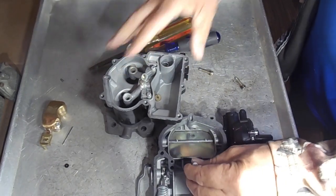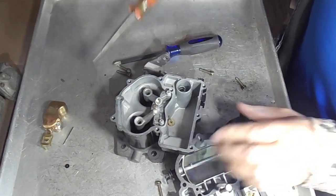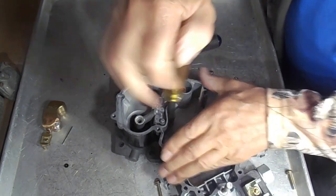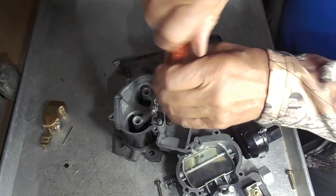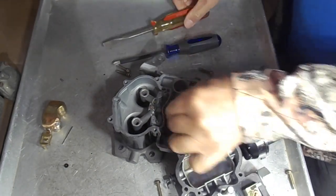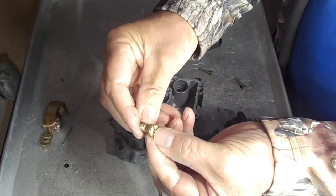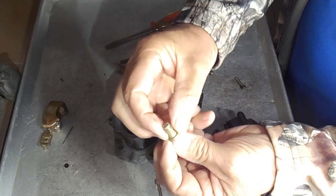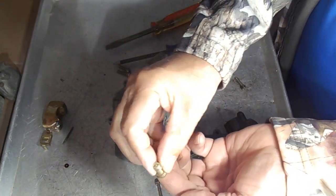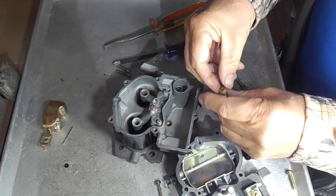So that's the piston. And down here is the jet. Our kits include a new jet at this point, though that may not always be the case. There is a gasket that goes on it. Here's the pin — that has to be straight. As the pin pushes down, it comes out the other end and allows extra fuel to go from the fuel bowl down to the main jet.